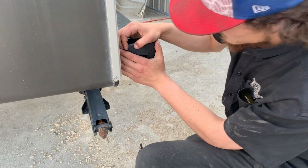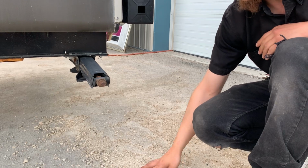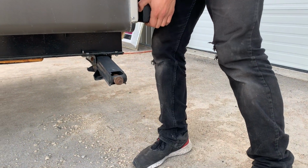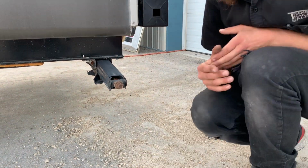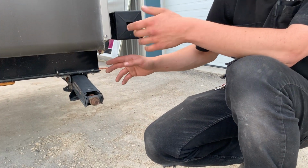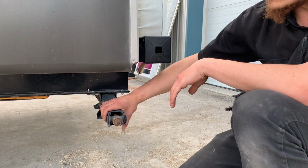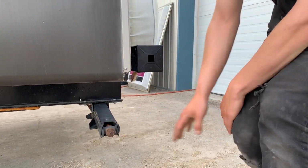And then down in the corner here, just got your little stabilizer jack. So as this guy comes down, it contacts the ground, and it'll lift the trailer up just kind of like that. Just a little firming off of the frame there. That's all you're looking for. What that'll do, it'll just take the sway out of the trailer as you're walking through it. You don't want to try to lift the trailer with them. They do generally just fold. They are fairly light duty.